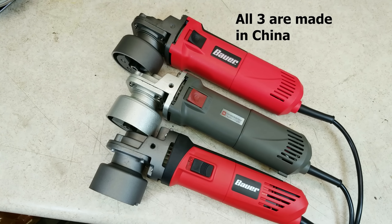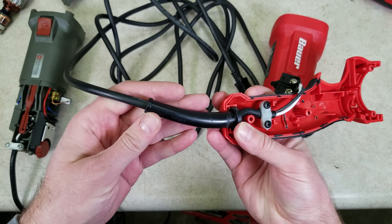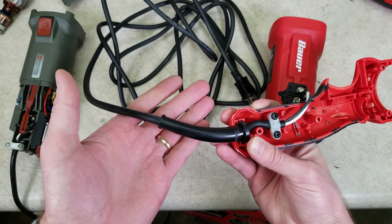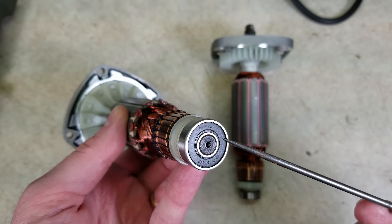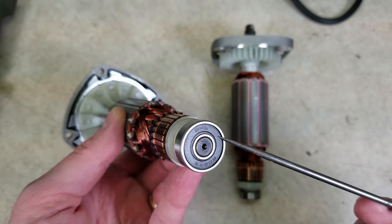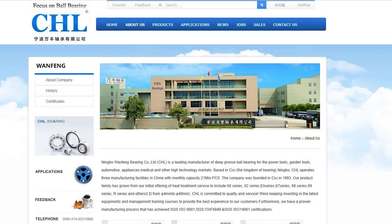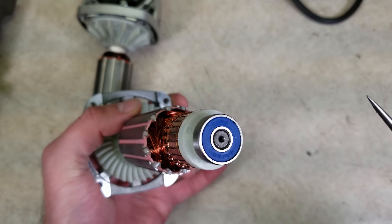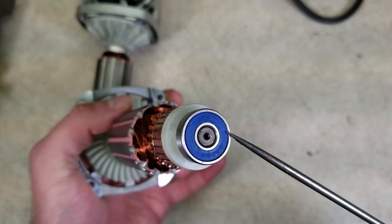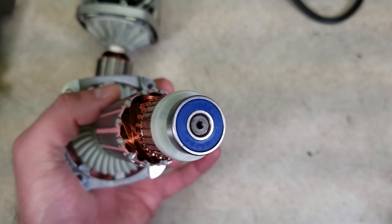On the newer Bauer versions they did put in a longer cord. The new one also has a nice beefy cord protector, which keeps the cord from sharply kinking over and causing it to fail. Looking at the bearings, the old one has sealed bearings — that's good, it helps keep out contamination — and there's a brand name on here, CHL, which is a mid-level Chinese company, so not a top shelf bearing but not a total no-name either. The new one also uses sealed bearings, which is good to see, but I do not see a brand name on any of these bearings.